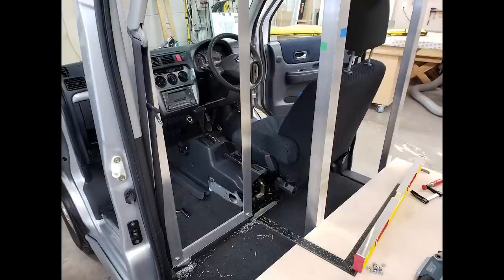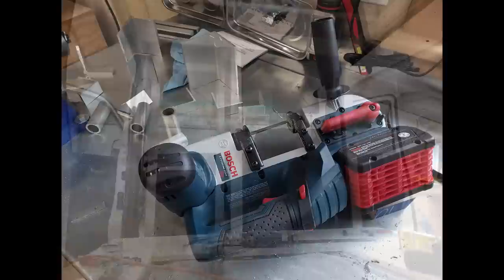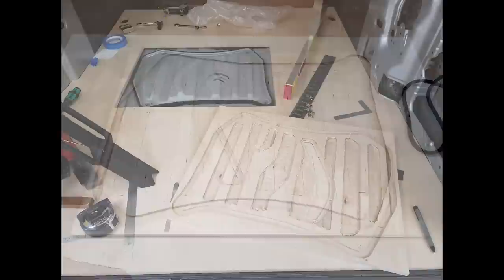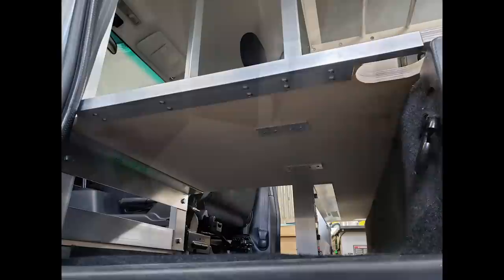I designed the divider to step forward on the passenger side to maximize cargo space in the back. All of the connections in the aluminum framing were made with bolts, washers, and lock nuts. I used a cordless bandsaw to make all of the cuts in the aluminum, which really sped up the process. With the framing done, I made a mock-up with cardboard of where the Baltic birch panels would be to ensure that all of my sight lines would be clear looking out the side windows as well as the rearview mirror. The engine hatch cover required routing out the profile of the metal engine cover to make it fit properly. I added some hardware and walnut edging. To complete the floor area, I made an extension piece where the divider steps forward and reinforced it with aluminum, since it bridges over open space.